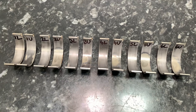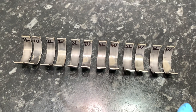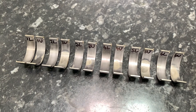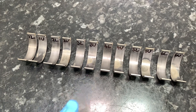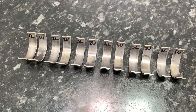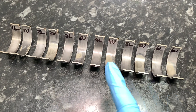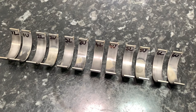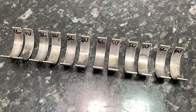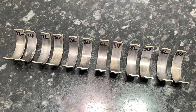These aren't the very first bearings that came with the car — this car has had the BMW recall. How do we tell? The part numbers are stamped on the back. When the S54 came out, through production they ran with part number bearings 437 and 438. These are stamped 439 and 440, which are exactly the ones you buy right now from BMW and were the recall bearings — currently still the only bearings BMW offer. So this car has had its recall done. The car is now on 108,000 miles and I couldn't say whether these were done at 10,000 or 50,000 — I don't know if you've got any records.